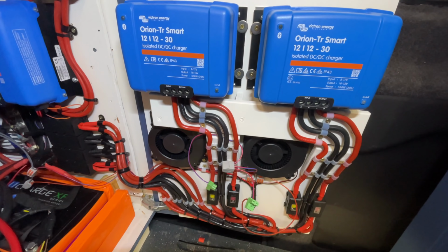So that's going to end this video. What I would want you to take away from it is, as long as your alternator is up to the job, it's no real problem adding two battery to battery chargers. Consider the wiring if you're going to use the engine detection. I made sure that all my wiring was equal, so both units were reading the exact same voltages from the van's electric side. Also, if you want to add a switch like I have, you can do it that way.